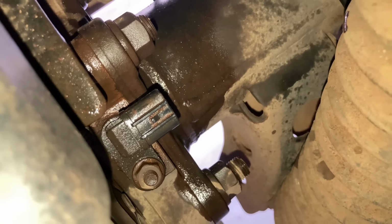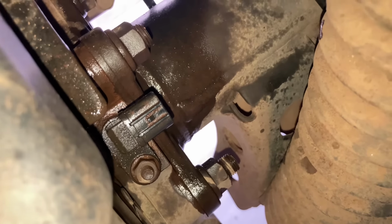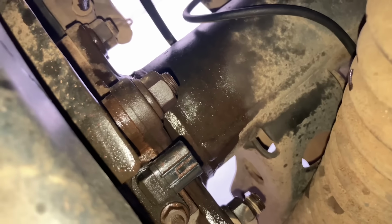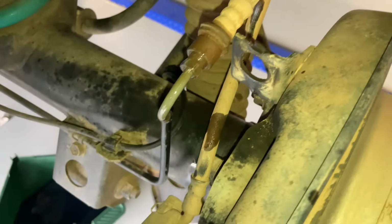If you wanted to, like I said, you get under that 10mm, pop the sensors out, give them a bit of a clean up anyway, but they should be pretty clean. If they're not, you might have problems. Don't forget replacing these axle bearings also at about 350,000 Ks if you're going to travel a long way from home is a good idea. Obviously, same thing at this side.